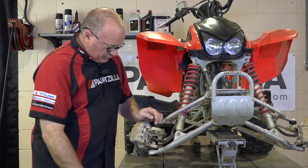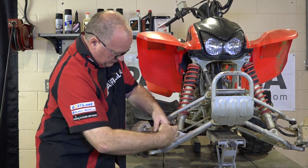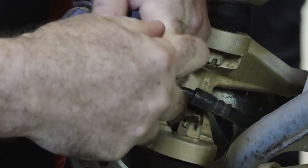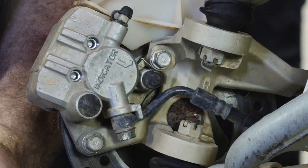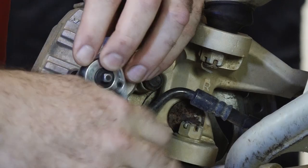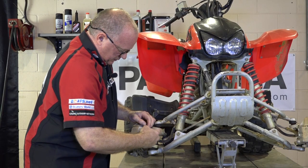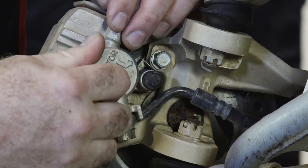The first thing we need to do is go ahead and remove these two caps that cover up the pins. These are just held in by a flat blade screwdriver, so not a lot of torque required on that at all. Under those caps you're going to have an Allen wrench — it's going to be a 5mm. So we want to loosen these both up, but don't pull the pins all the way out. Thread them back and just let them sit like that, because they're actually still holding on to the pads themselves.